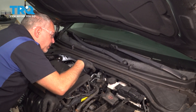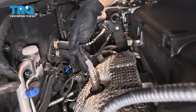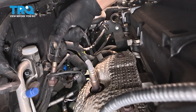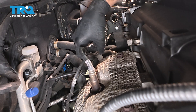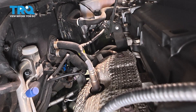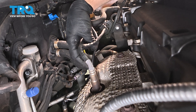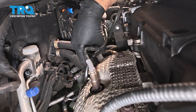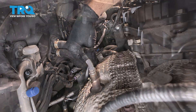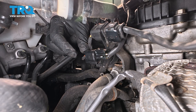From the top of the engine bay, go between the top of the engine and the wiper cowl area and straight down the back. Pull up the sensor, then separate the harness from the retainer by opening up the tab and pulling up. Grab the wiring harness for the new sensor and work it into that clip, bending over the tab. The lower connector you need is right here on the back side — press down on the little spring clip, then pinch and wiggle it off.